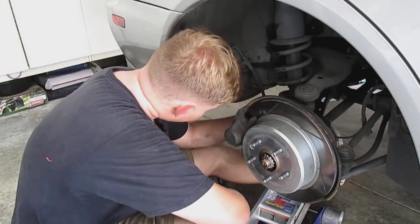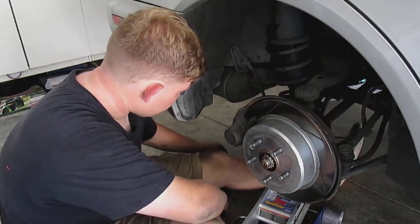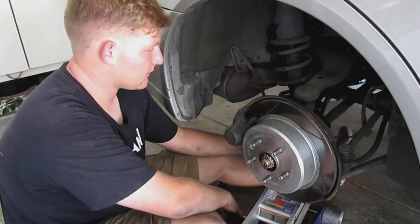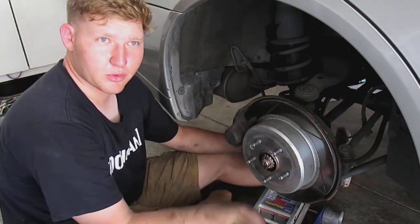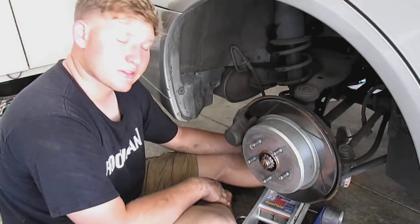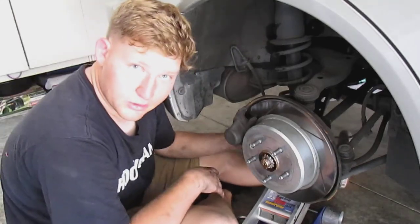The rear — the very tiny rear sway bar has to come unbolted. There's a 12 millimeter bolt in the back. You'll see it's kind of up the control arm a little bit, and then the brakes can stay exactly where they are. You don't have to remove the caliper or anything for ease of access. It's pretty easy to reach it. So all you got to do is just zip off the 19 millimeter bolt that's down here.